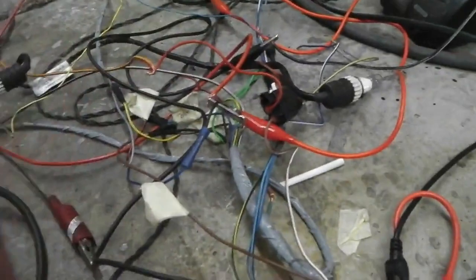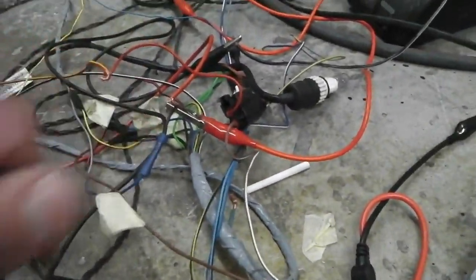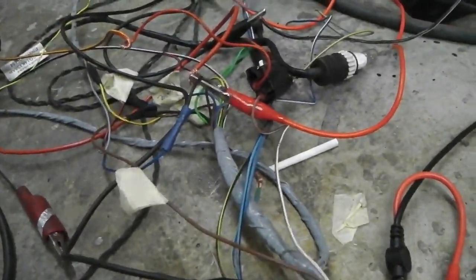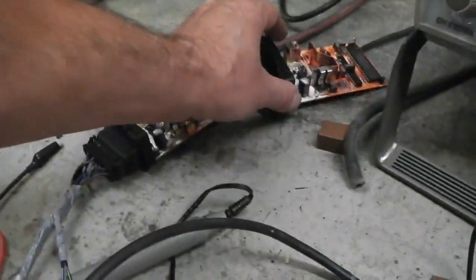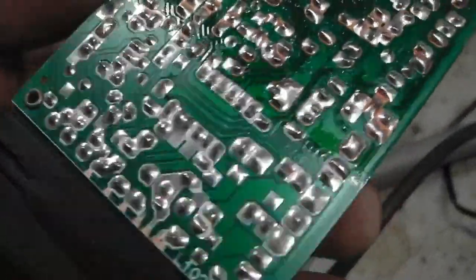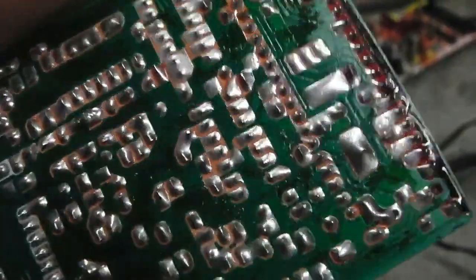Because I was building the looms and then my brain just unfolds and little clips and things appear. I know what all the wires do. I've marked them, so I do know what's going on. Two units, because one was giving me intermittent faults. However, I've managed to repair both units now, and all I did was re-solder some of the bad connections on the board. I had to take off the protective coating.